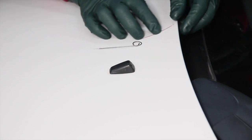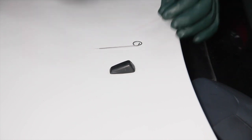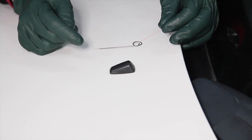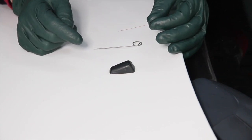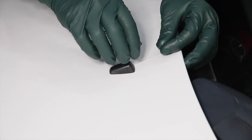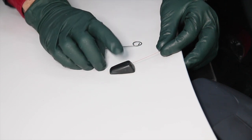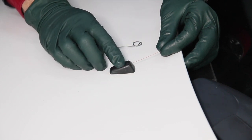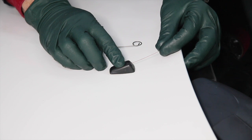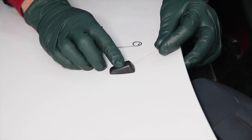And I remember I got a little wire. I'd stick the little wire down in there, and if it was small enough to go into the hole, I could clean the hole out. Generally, the wire wasn't strong enough. Sometimes it would work. It depended a lot on how tight those nozzle sockets were, and sometimes when these cars sit a long time and they're not adjusted, they get really stuck, and you have to have a very, very strong tool in that hole to get them to move. Once you get them to move and exercise them a little bit, then it's much easier to adjust them.